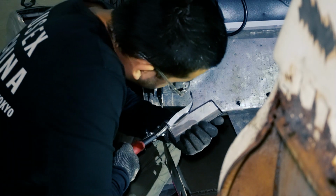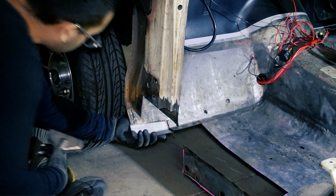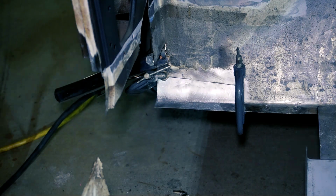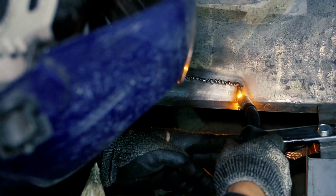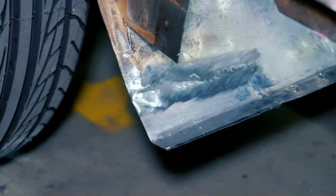I know it doesn't look like there's a lot of car left here, and there really isn't. There's a lot of thinking happening between each of these shots and before every chop to ensure I don't remove too many points of reference that help me in my repairs. I also don't want to chop too much of the car to avoid the whole shape of the car warping, resulting in a banana of a Datsun 1200.